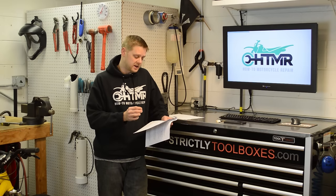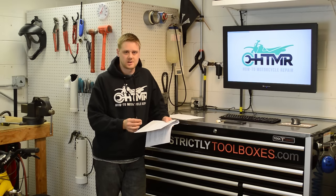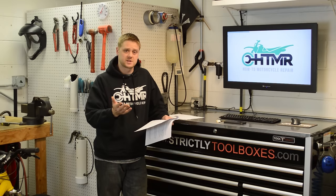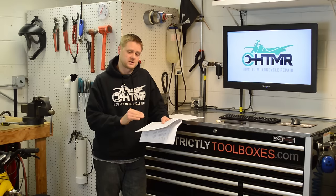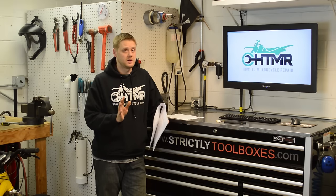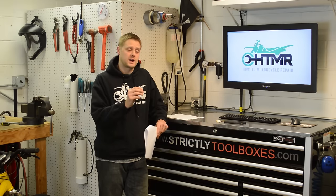So really, it could have gone one size larger on the Pilot, to say 37 1/2, to get those fuel screws right at 3 turns, which would have been perfect, but it ran good. Okay, so we're gonna head over to the whiteboard.